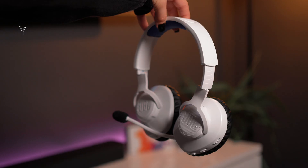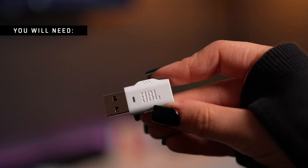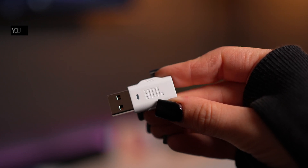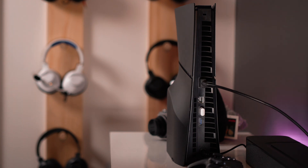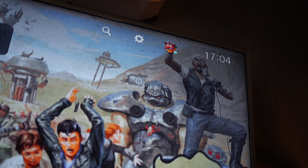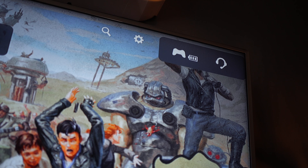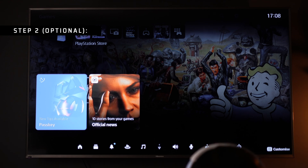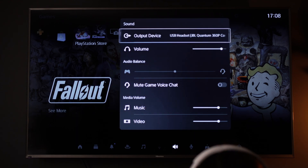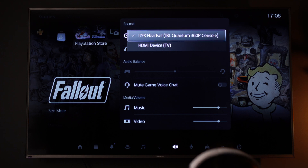So let's set it up, starting with PlayStation. Before beginning, make sure your headset is charged with the included USB-C cable found in the box. You will need the headset and the USB-A dongle. Step 1: Plug in the USB-A dongle into your PlayStation console, then turn on your headset. It should automatically pair, but if not, there is a connect button on the dongle so you can manually pair it. Step 2 is optional, but if your console doesn't register the headset's connection, you need to change it over in your sound output settings.